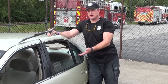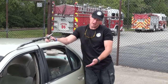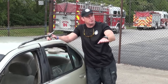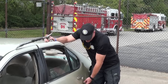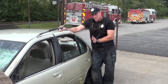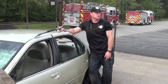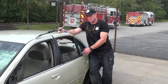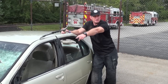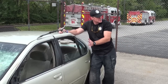You also have to be conscientious about your B-posts and what side-out techniques you're going to use — whether it's a fold down or a rip and blitz. If you've got a lot of midpoint intrusion on a patient's hip or femur causing them pain, especially when a high-profile car T-bones a low-profile car, reinforced bar segments through the middle of these doors will carry that B and fold it right over their hips. A compression pushing forward and in towards the victim is not well tolerated. In those applications, you're better off removing, popping, or cutting your latch assembly, then popping or cutting your hinges, making a cut on the B, and taking all this material out and away from the patient in a fold down — as opposed to a forward compression, rip and blitz, or two distinct door pops and a B cut.